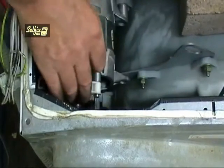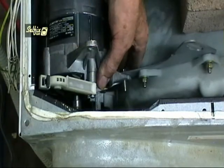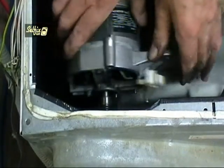The back end of the motor hooks onto a moulding on the container and the front end locates onto a metal bracket which is also attached to the container. Bolt the front end of the motor to the bracket and tighten it, but don't over-tighten it because you've still got to pivot the motor over to fit the other bolt.